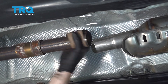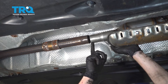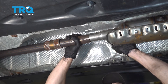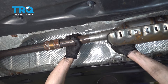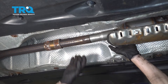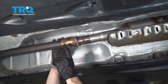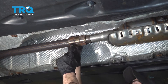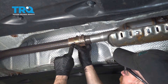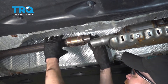Clean down the pipe in the back. To connect the two pipes, butt them directly up against each other — grab one and pull it right up against the other. You'll need to slide the clamp over and lock it down — this is typically easiest with two people. This is double-layered, so you'd be able to see a secondary slot behind here. Make sure the two slots do not line up in any way.